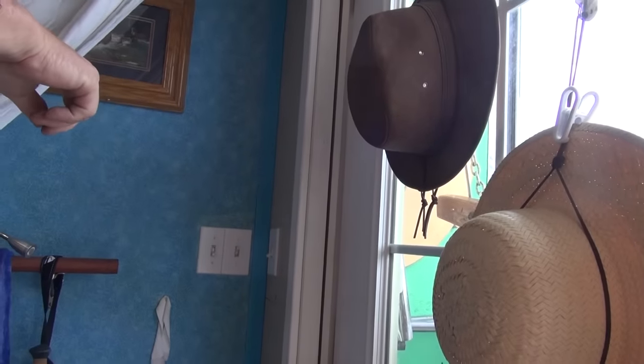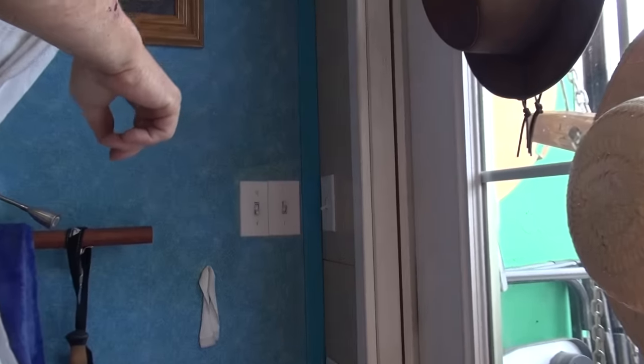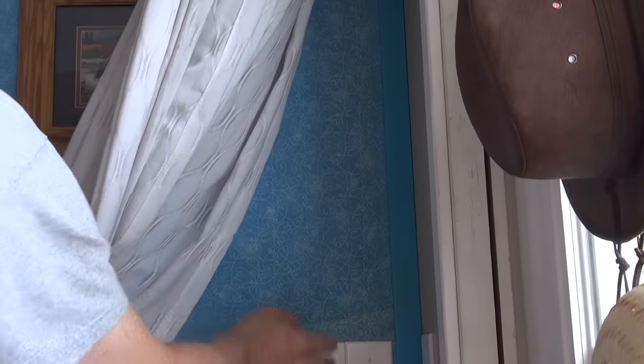Let me show you a little about the electrical. There are three switches back here, and they're all three-way switches. The back one turns on the back light, with a corresponding switch outside. The middle one turns on and off the bedroom light, and there's another switch at the head of the Murphy bed so you can turn the bedroom light off when you're in bed. The third turns on the main cabin lights, with another switch up front. Three-way switches make it really convenient to move in and out of the vehicle.